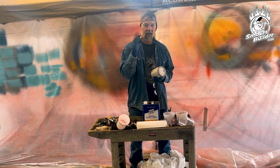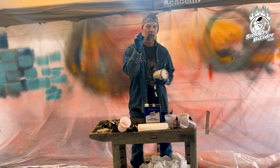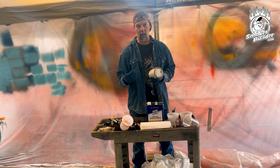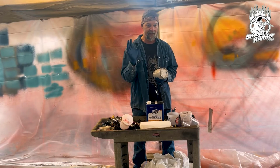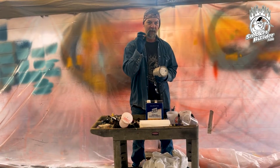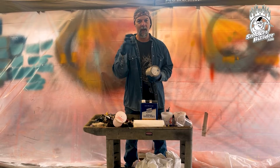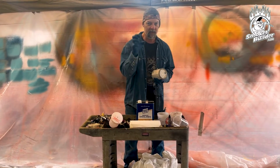So like you get this really nice paint job, you walk away, you come back, and the paint has actually retracted and wrinkled up off the surface. Usually that's an adhesion problem caused by either surface prep or something to do with chemical makeup of the paint, or something else that is like off-gassing. So as paint is curing, the chemicals and stuff in the paint, like the mineral spirits, the acetone, the fumes, they're all trying to get out. And the moisture, it's trying to dry out and cure. And so if for some reason the paint is applied wrong, that would cause that problem.